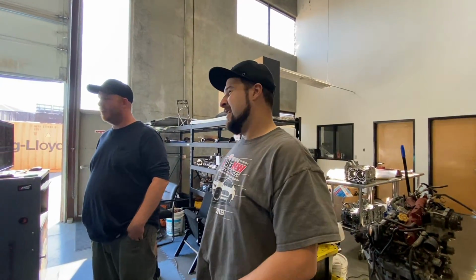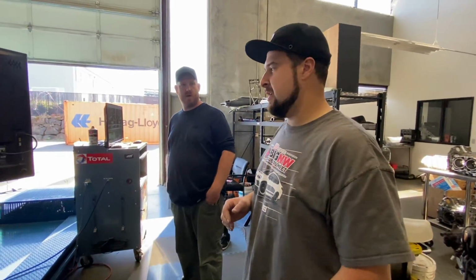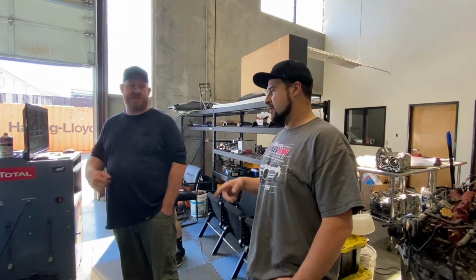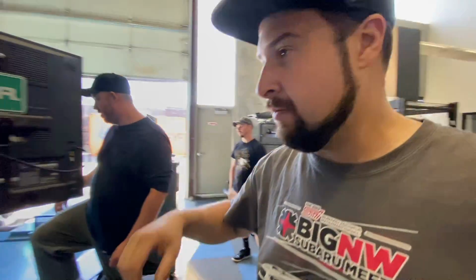Okay. So we have an issue. We're not hitting 100% throttle. We're getting like 71%. So you said you had carpet that might be too thick. That they double layered, and I put sound deadening on top. All right, you want to go ahead and try to see if you can correct that, or we can look at the throttle cable real quick.